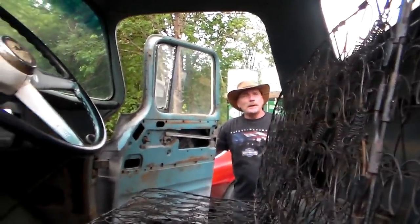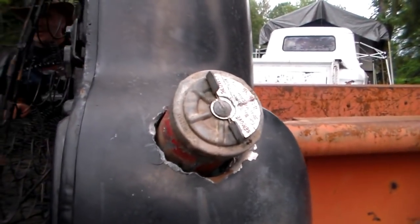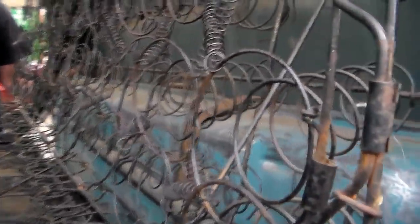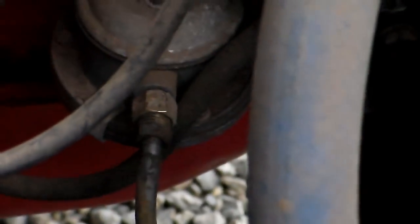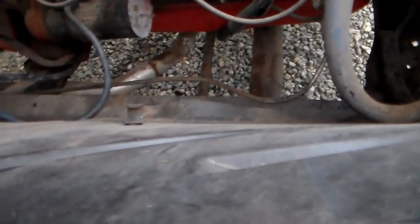Oh, I know what else you did. What else did I do? This gas nozzle. Oh yeah, that doesn't look real good, but I put the gas tank in. Actually ran metal fuel line from the engine. If you come look over here, you don't want rubber hoses up next to your engine. I installed the metal fuel line going to the fuel pump, and then it goes under the cross members and down the frame, and then goes into a rubber one.